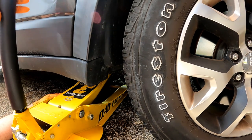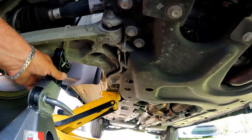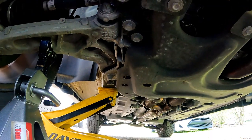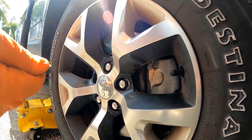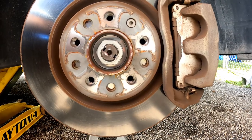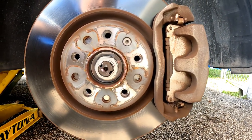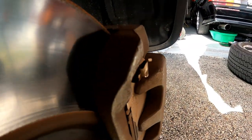After chocking the back wheels, we jack up the front passenger side wheel, place a jack under the lower arm, and then lower the jack keeping pressure on it. Using a 19mm socket on an impact gun, we take the lug bolts off the wheel. From 2015 models, Jeep has made many improvements, and one of them is the accessibility to the ABS speed sensor.